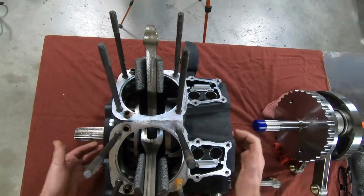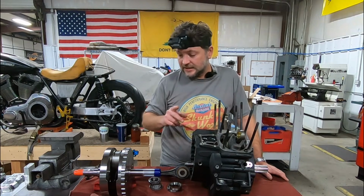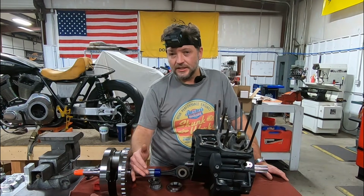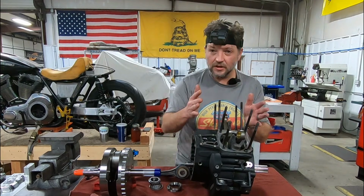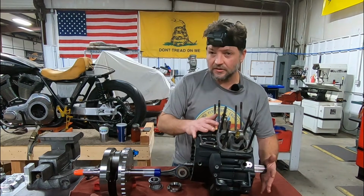That's a considerable amount, 1/4 of an inch, give or take. So remember, I said that for the most rigid structure, we want to be able to set that crankshaft in play so that it's not reliant on any other components to hold its center line. That's where things are different on the stock roller bearing setup. You can see how much the crank shifts back and forth.